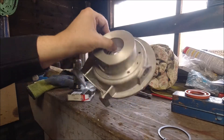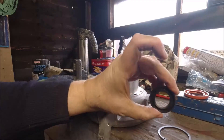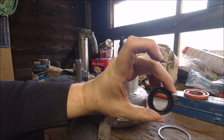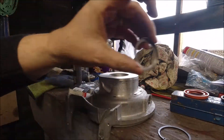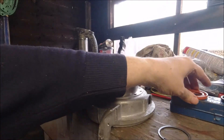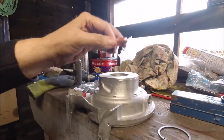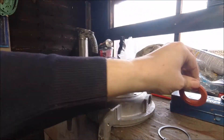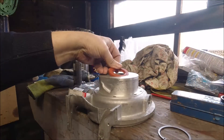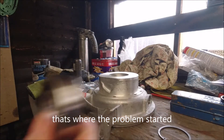If you look at the inside here, you've got an oil seal — the spring always faces what you're sealing against, so the spring faces inwards. Then you've got a spacer, then your bearing, then your secondary oil seal which seals with the crank. You want that facing you, not away from you, because you're sealing the bearing which is packed in grease.